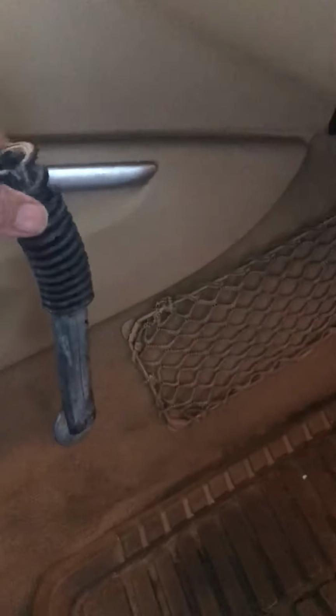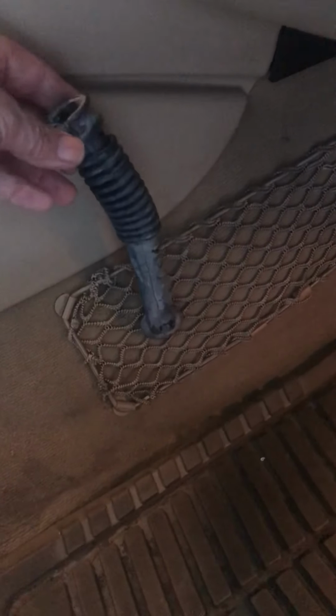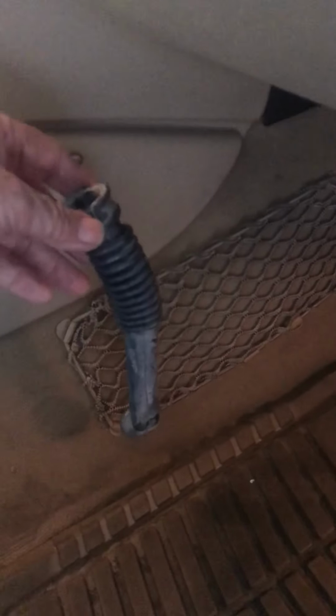And when it falls off, this hose that mounts right here inside the car, underneath that cover and underneath the carpet, there's an opening in the firewall right there, in that side cover, not the firewall. But this thing just hangs out like that, and all your condensation, both sides, will drain into the floor and into that battery box.